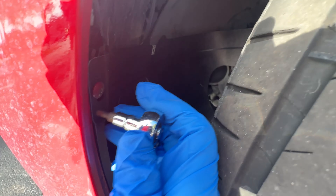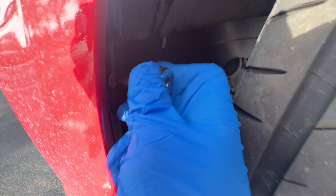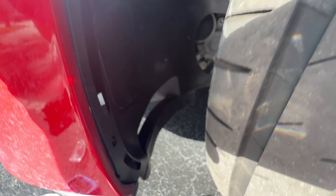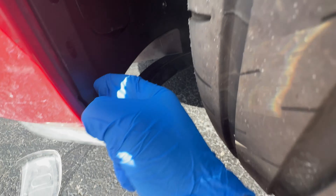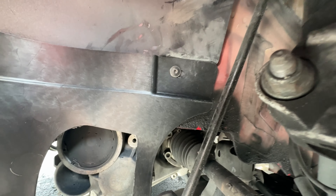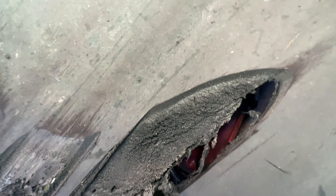Once you've got it into place, it's easiest to do these Torx 30 or T25s over here first, just so you can get it to line up at the top. Then you can basically move everything else back into place and you're good to go. There's realistically only one, two, and all the way in the back, three Torx 30s holding the lower fender liner in place. There's supposed to be another one here but that section's missing. I think we're going to be good.